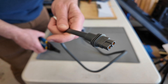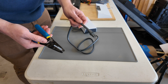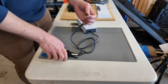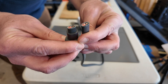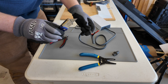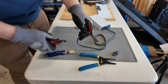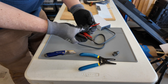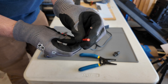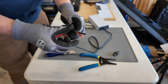We're going to cut this one end off of the power input to the DC to DC Starlink power supply. I just sort of like to do stuff and figure it out as I go, so I'm not going to overthink this one too much. I'm just going to cut this off close to the connector. And then you can see here, it's just two-pair wire, a red and a black. So I'm going to cut back some of the sheath so I can get the wires out and then put some terminals on it. I just use a knife to very carefully put a slit in this wire — it's very much like working with Romex. I'm going to get some side cutters and just snip this gray sheath away, make it a little bit easier to work with these other wires. It's two-pair, 12 gauge. I'm going to strip these and then get some ring terminals and heat shrink to clean this up and get a nice end on this to connect to the truck camper.